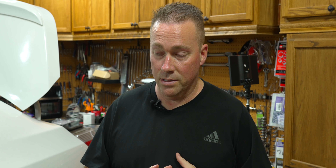You can see the control arms are totally roached out as they always are at this mileage. There's a little bit of oil seepage but nothing's actually leaking, so that's good. Looks like maybe a little seepage coming out of the oil ring — I didn't order those so we might have to order a set. Nothing's actually dripping in the pan or on the ground. This is a typical S85 setup — S85 is actually a pretty good setup. All factory converters, all that kind of stuff, no issue at all.